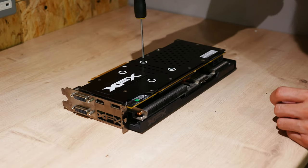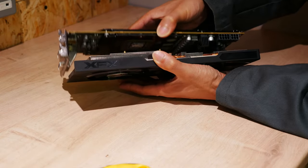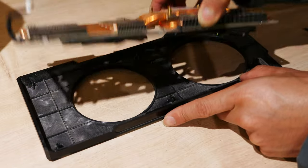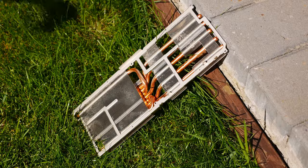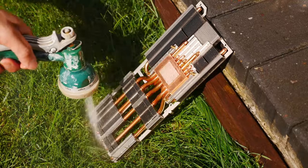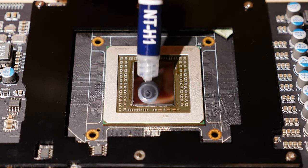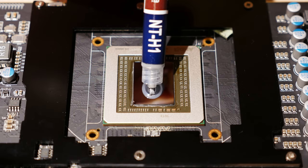After the first tests, taking this card apart is pretty straightforward, with 4 main screws to separate the heatsink and 6 smaller ones to separate the shroud. It's not too bad dirt-wise — let's get this gleaming. Now that is a large die. Our thermal paste here is Noctua's NT-H1, and this is then tested again.